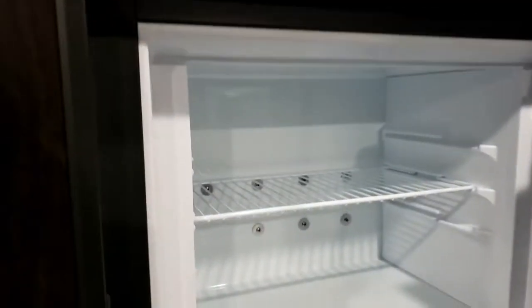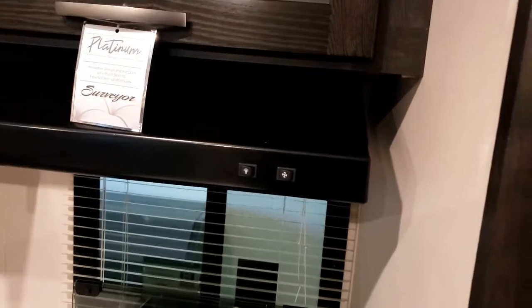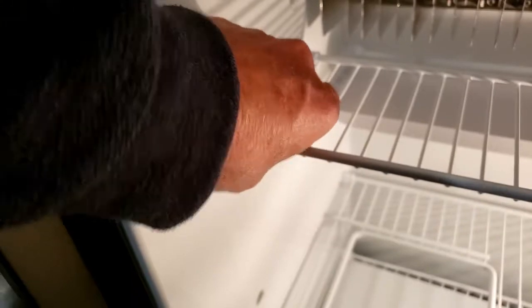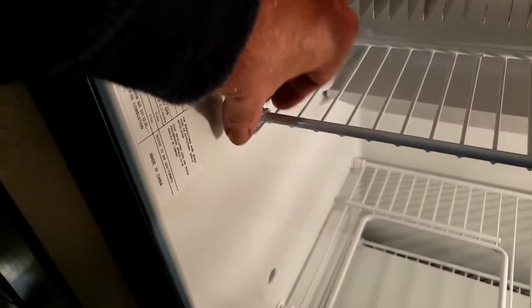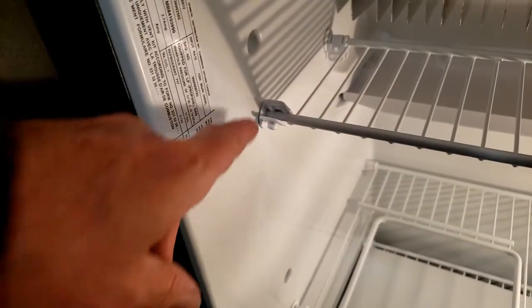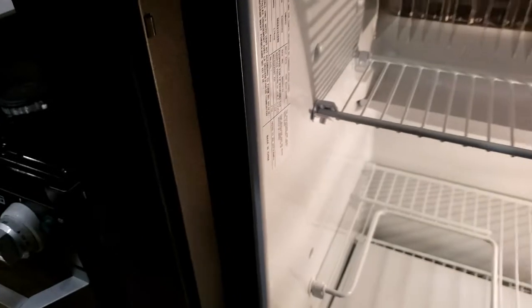Your freezer in here — you can move the shelves if you like. These shelves down in here will move as well. The side with the little clip on it: these little clips split apart, just pushes apart like a clothespeg. Then this little white collar back here slides out, and you can pull the shelf out and change the position of it.